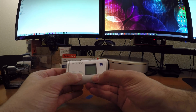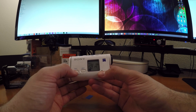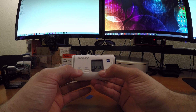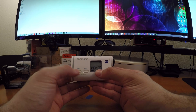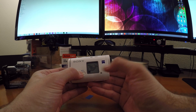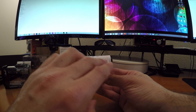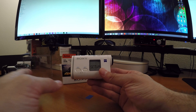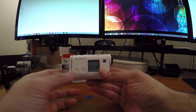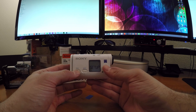We have the similar watch-style LCD screen that's been on pretty much every Sony action camera — same as before, except there are a lot more options. One change that keeps throwing me for a loop is that 'loop' mode is in the front of the menu; I'm used to pressing previous from movie mode and hitting power off, but now I have to go one more step. There are a ton of new options, including how to change field of view — from wide at 170 or medium at 120 — and you can do that at 4K, 720p, or even 240 frames a second. It really doesn't limit you, except when enabling SteadyShot.